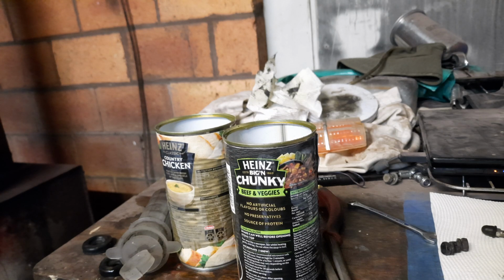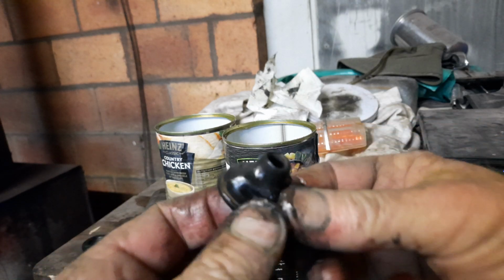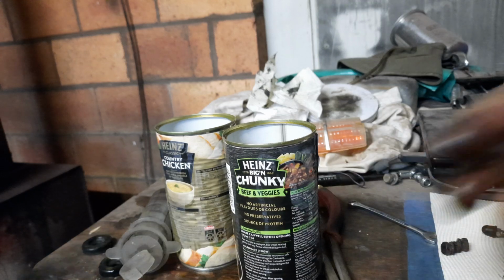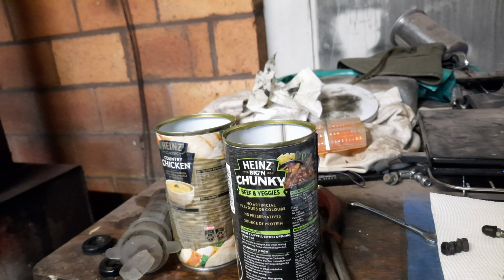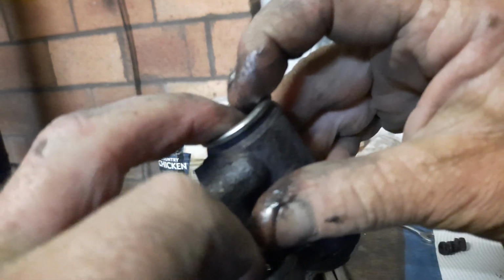When you put your seals in, make sure they don't go in crooked, or they'll just pop straight out again. Get the other cap ready. Once again, you can turn the rubber inside out. You can even, now that you've got the cylinder assembled, just had it pop itself out. Yeah, can even run some grease around the top of it.